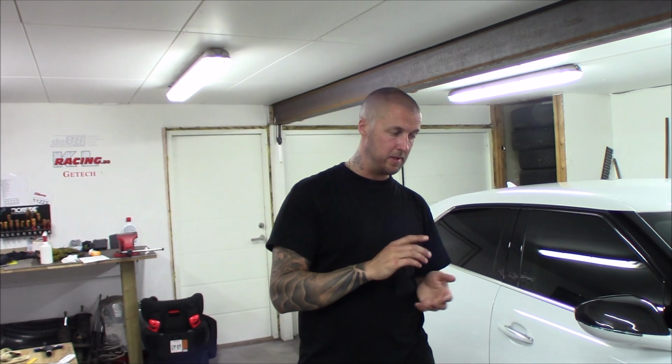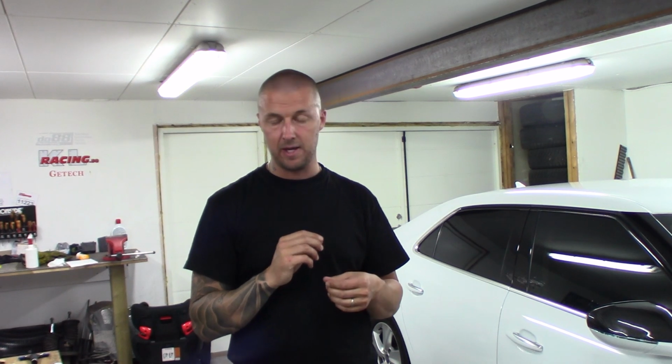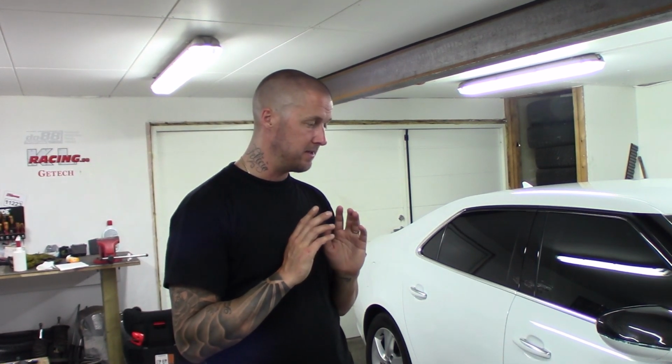And some of you may wonder, why do you not put on the new wheels, the 20-inch Lorenzer? I don't know if I have explained that before, but you need a conversion spacer to get them on. You can't even test fit the wheels because they don't go on the pin bolts. So the way I'm going about this is I'm going to lower the car with the coilovers, then measure on these wheels and try to calculate so I get the correct measurement straight away, so I can order some spacers and then throw on the wheels. So I think next up will be coilovers or the front bumper. I don't know, either or.